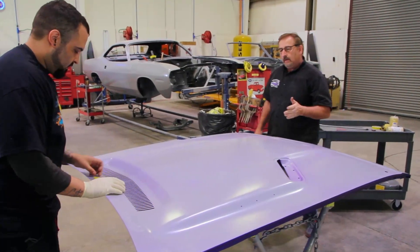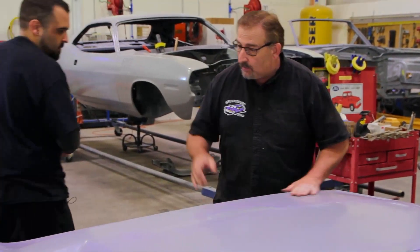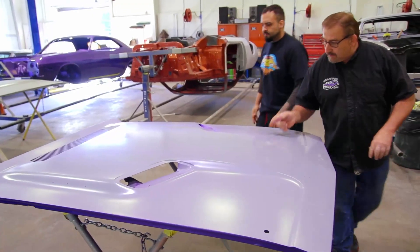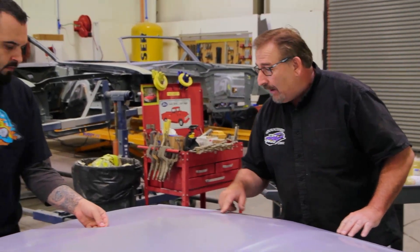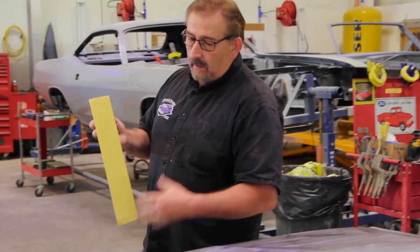I want to work with you on this — it's very important. I think I'm going to go 220 and 320. 320 can glide over the top of this peel and leave some peel in it and you'll never get it out. 220 will take the peel out. I want to use guide coat on it. Remember, we just want to make sure that we're cross-blocking and that we're not causing dents in it.